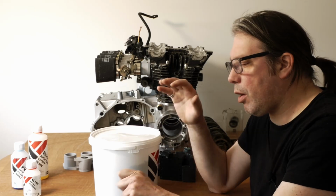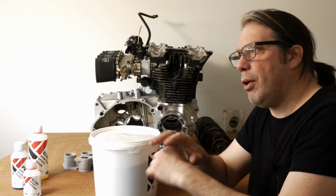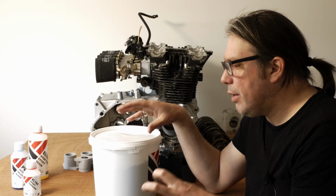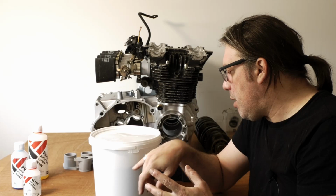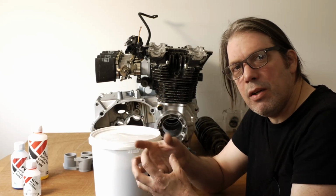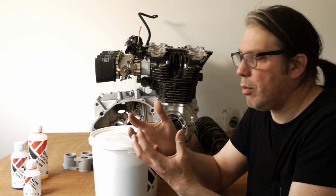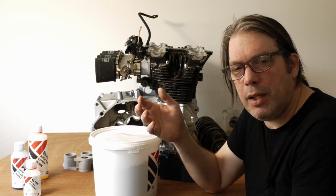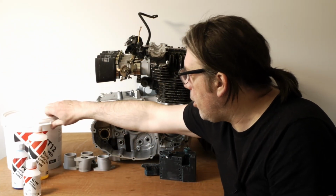And you make sure that when you close your mold, it's got some squish, that the part you use to close the mold is actually compressing everything, and you clamp it in a vise and squeeze the whole thing. And in theory, that squeezes out the excess resin, consolidates everything, allows the fibers to move around and fill all the voids in the cavity, and let that set. And then when you demold it, you've got your physical part in a medium that's a proper structural medium. It's proper carbon fiber. So I thought we'll give that a go.